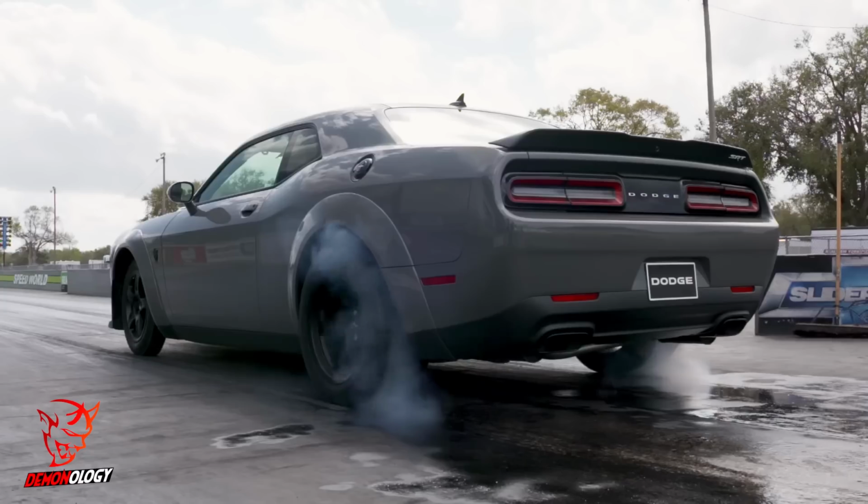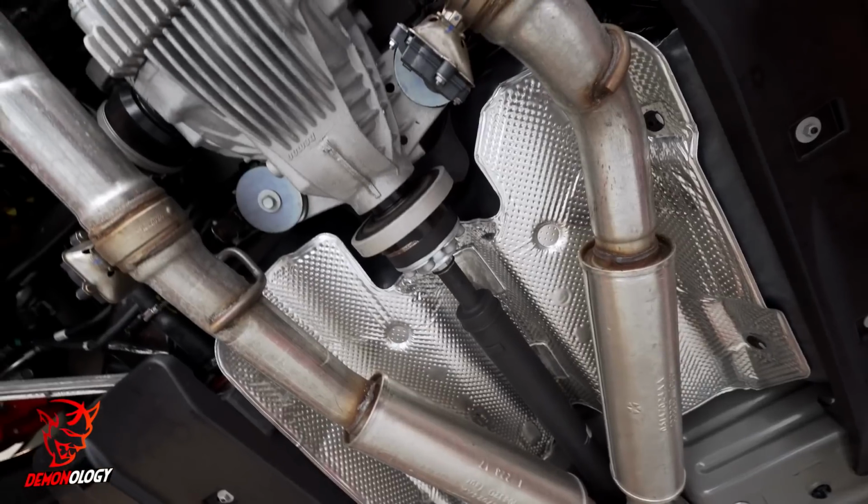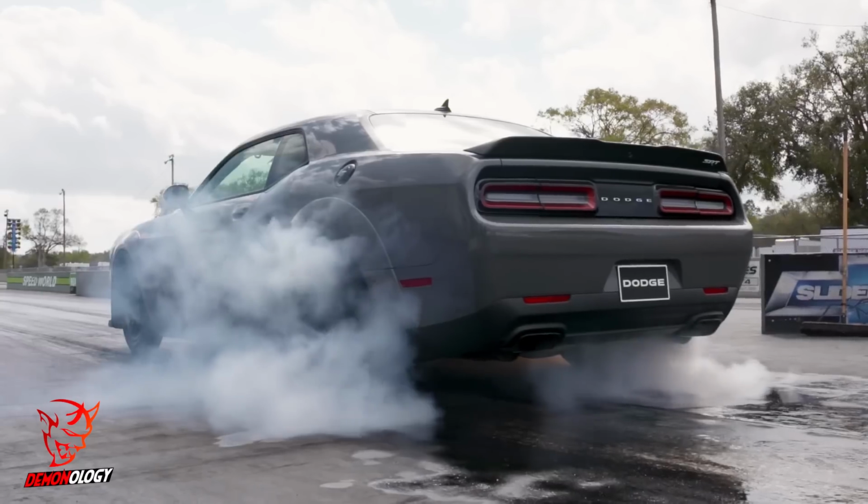It's a really good way to break parts, because what happens when you're doing your burnout, you just put a contact patch of rubber on the surface. It's very sticky. Okay. If you take all the torque away, you're liable to stop the tires instantaneously. So it's just going to shock everything. Put huge impact loads into the drive. Okay. So you want to drive the burnout out.